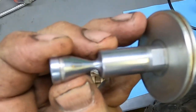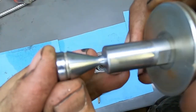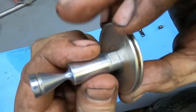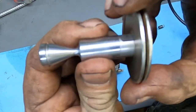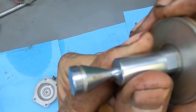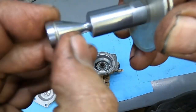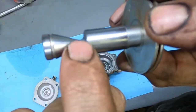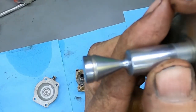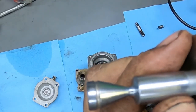If you want a little bit more power without spending any money, look at the pin — it's eccentric. Take the AFC top off with a 10mm, pull the diaphragm off, and roll the pin around on a table to find the lowest or most pitched spot. On this pump it was almost in the high spot rather than the low spot. If you put it in the low spot, you will have a little bit more power — maybe 5 to 10 horsepower.